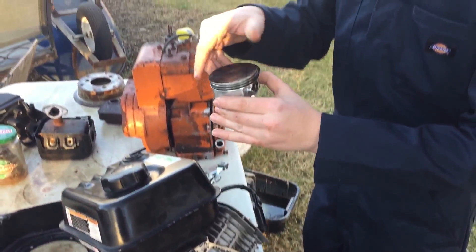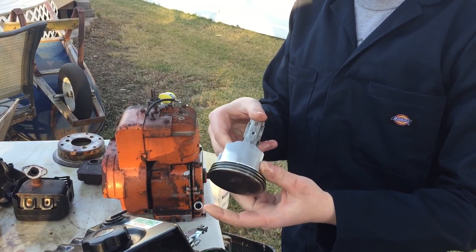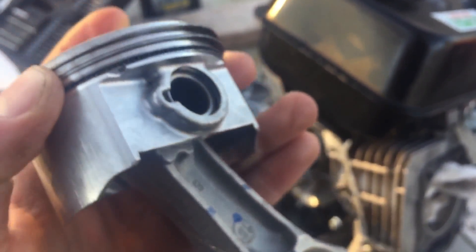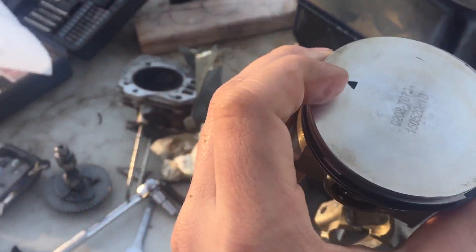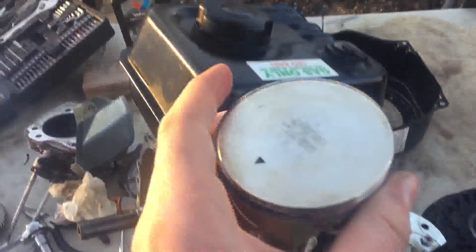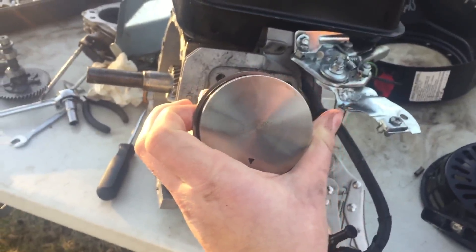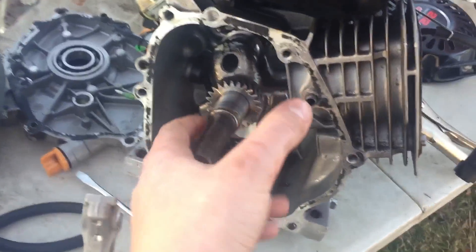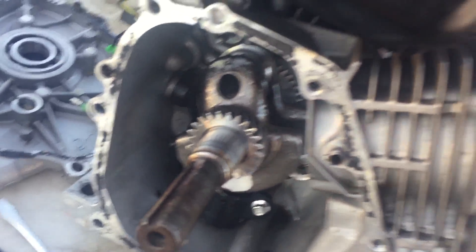So I have the lower cap off and now we're going to take off the piston. Here it is — it actually looks pretty good except the top, which I'll have to clean up. I cleaned up the piston and there's a really small indentation there, but that's not really going to affect the engine from not running. It looks pretty good. Also, if you take apart this engine, the arrow on the piston means that's how you have to put it back in. I don't think I have to take out the crankshaft — everything looks fine — but the rod journal looks a little messed up, though that should be fine.